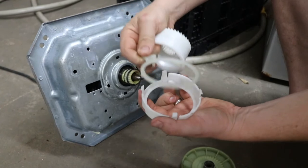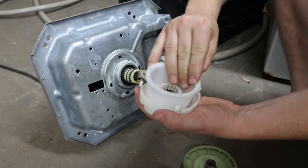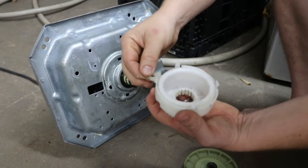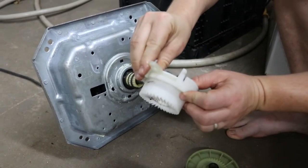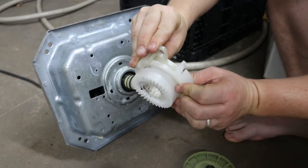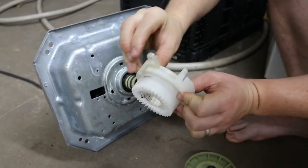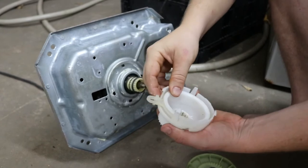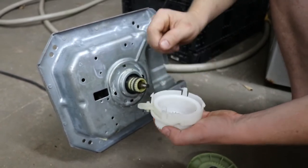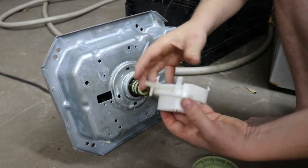So it's just three plastic parts. Super easy to clean it back out. It should easily slide back and forth. And what's happening, you can see it's going uphill as I push this. It's riding a little ramp and it's just pushing it up the hill. So I use white lithium grease to fix this problem. So that's what I would suggest.